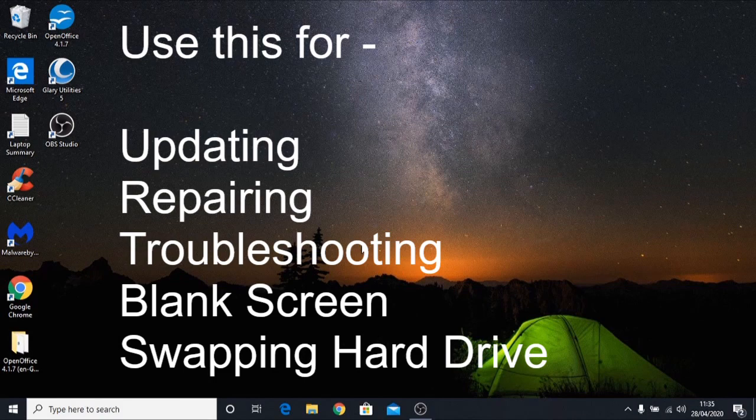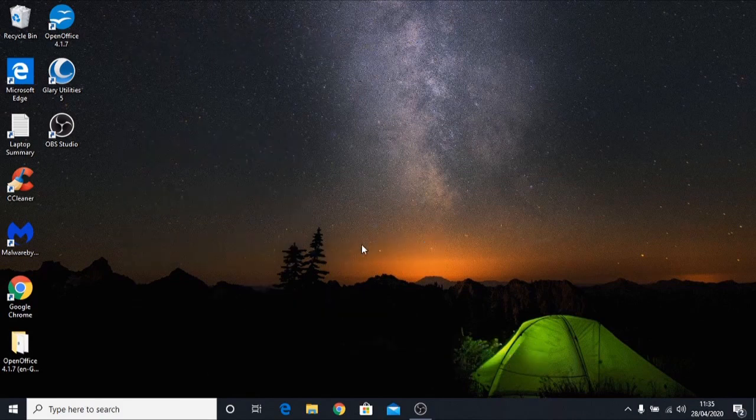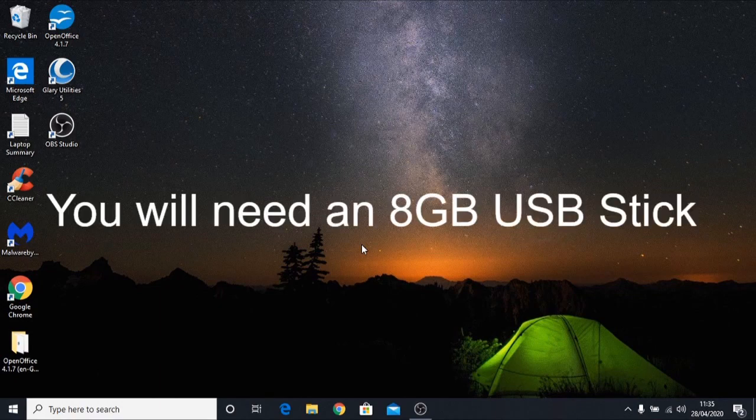We're going to need a USB stick and we'll need to go to Microsoft's website to download one of their OSU files. There are now three files: OSU1, OSU2, and OSU3. If we can't update the console this way, you will need to try resetting your console to factory settings, which will scrub your hard drive. Failing that, you may need to upgrade the hard drive completely. If you want to swap to a bigger hard drive, you will also need the OSU1 file.